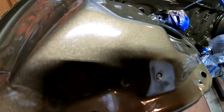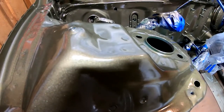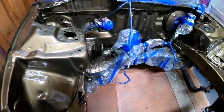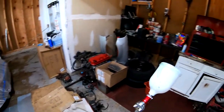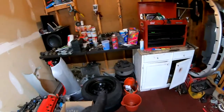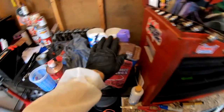So I'm going to go ahead and mix my clear coat. This one's 4 to 1. That's how we're going to mix this, 4 to 1, and then we're gonna go ahead, filter it onto the gun. I already cleaned the gun. I disassembled it all the way and reassembled it. Then we're gonna go ahead, get that football shape, that pattern, shoot it in here.